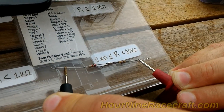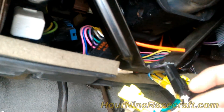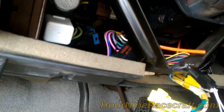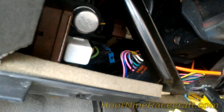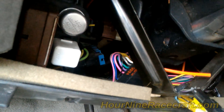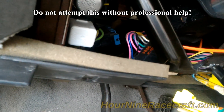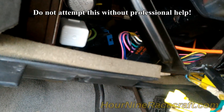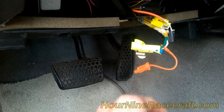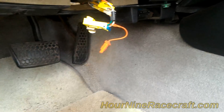To disconnect the connector, I grabbed a small flathead screwdriver and pried up on the edge just enough so that little plastic prong clears the metal flap that locks it down. Once it's up, you pull it out — that's the connector that loops back. You can check your service manual wire diagrams. Try not to use a multimeter to test this connector because you could fry your immobilizer or the car's ECU. We've also disconnected the airbag system — that yellow connector — and disconnected the battery as a precautionary measure.